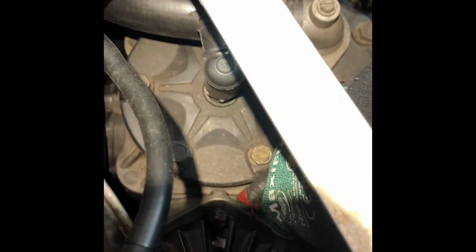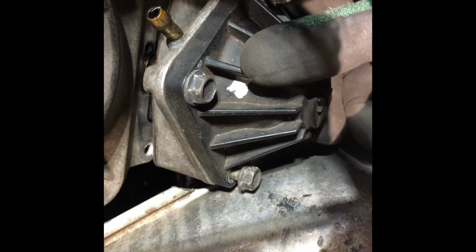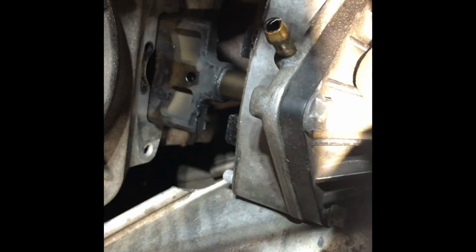We're gonna need a 10mm wrench. That's only gonna be 1 and 2, not the top and bottom bolts, just the side ones. Will pull it out of the engine block. Both those bolts loosened off now, and we can slowly, carefully back him out of the engine.